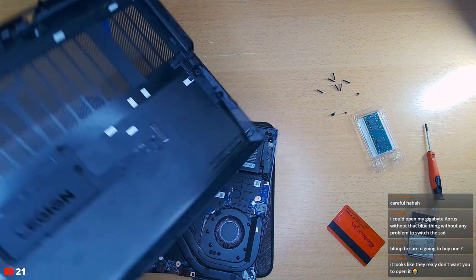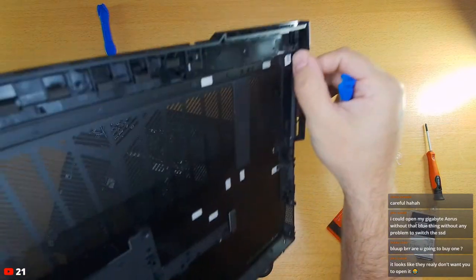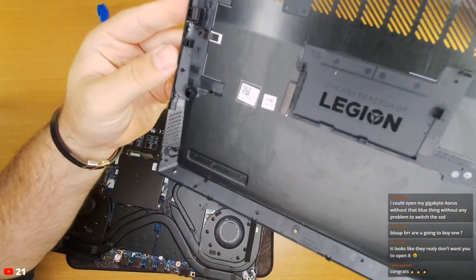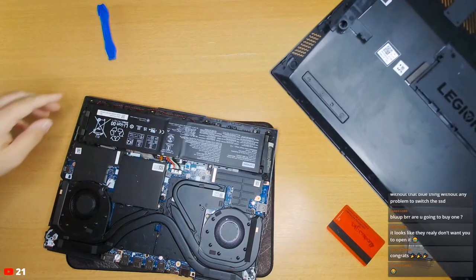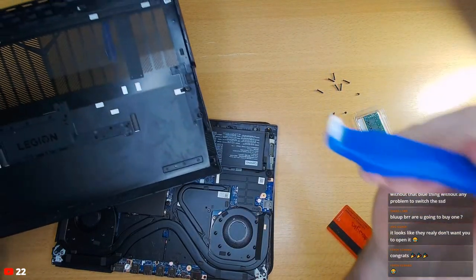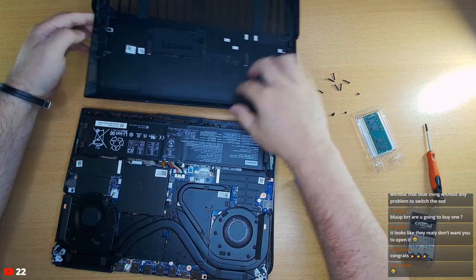We got it open. So these are the things. If you look inside, there's little clips over here. These make it very difficult. These are really, really tight. Now, for anybody who's gonna open it, this is what the inside looks like. These are difficult. And you wanna start at the front. So if you're gonna pry it open, you wanna start at the front, and do use tools like these. Very small tip, they get bigger.